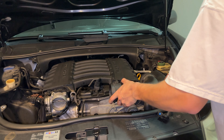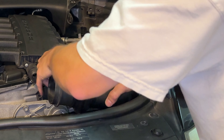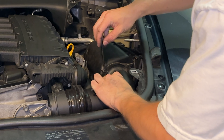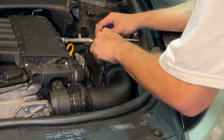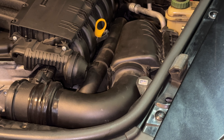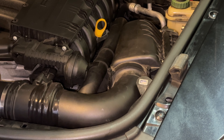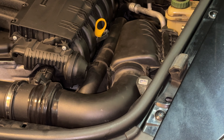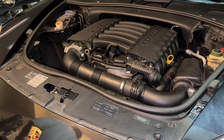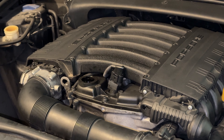Reinstallation: reinstalling these Torx bits is not much of a challenge. Reinsert the hose, making sure to pass the MAF sensor behind it first. Plug the connectors in and plug the MAF in while you have easy access. Reinstall the Torx T30 screws — easy installation. Twist the clips 180 degrees so they match up and are in the locked position. Then reinsert the hose into the throttle body — that might also take some pushing. Tighten the clamp without over-tightening it. Put the engine cover back on.